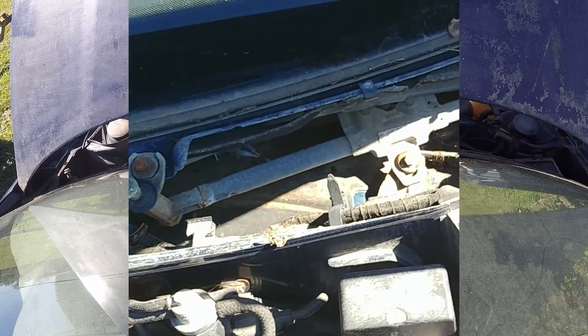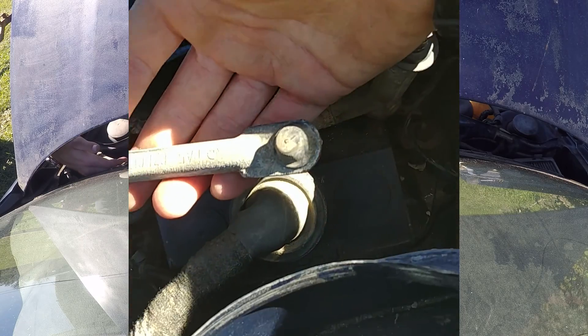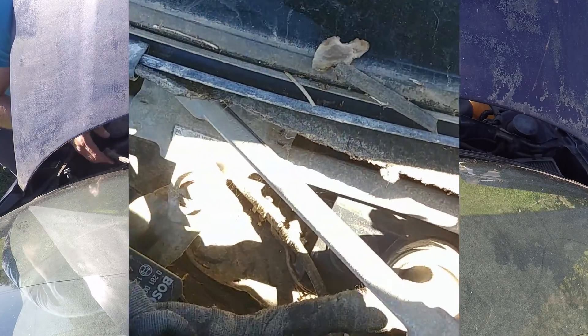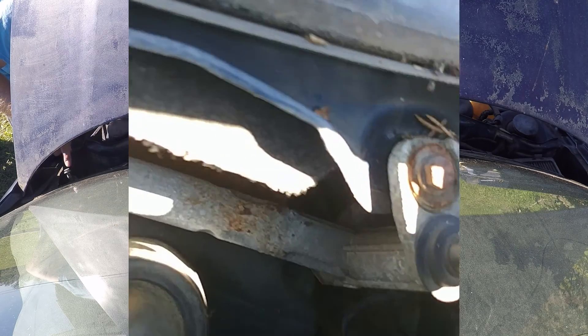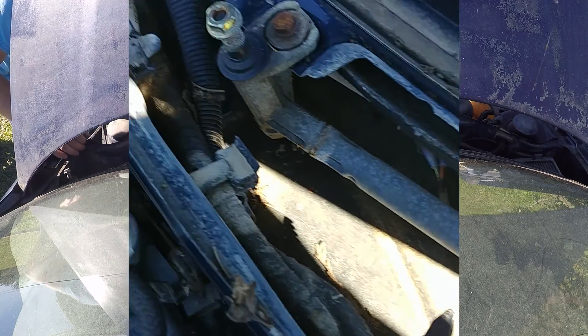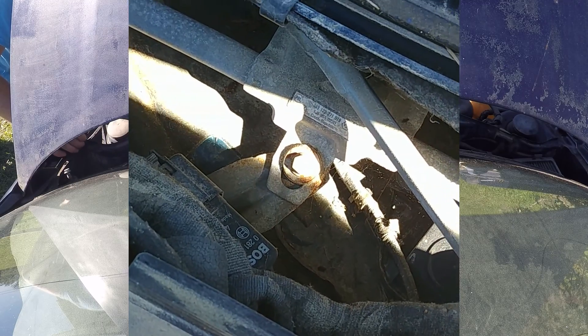While we've got this apart, there is right here a broken arm for the wipers. This is the clunking I was hearing when the passenger side wiper would operate and the driver's side doesn't move. That rusty-looking arm is supposed to turn the shaft for the driver's side wiper. It's seized in here somewhere, so I'm just going to swap the whole mechanism - I have another one from another car and I'm going to go ahead and pull that.